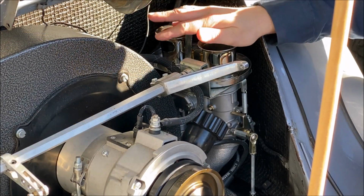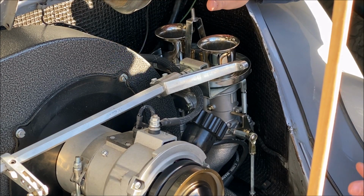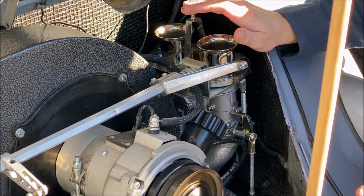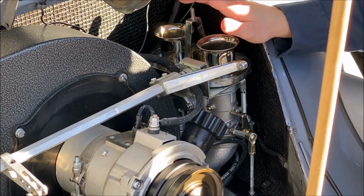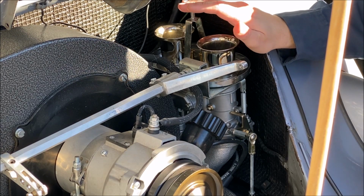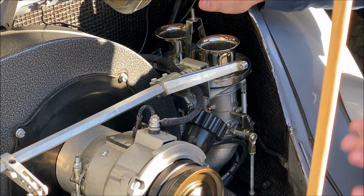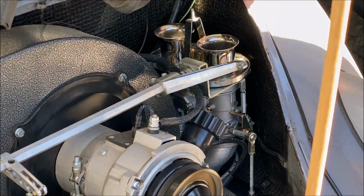That's fun. If you guys remember, these were the very cheap carburetors that I bought from CIP1, and I did kind of what I'm sure everybody does, but what you shouldn't do. We bolted them on. We didn't open them up and clean them out like you should, so that could be part of the issue. Something clogging the needle seat just from us not cleaning them before we put them on the car. But man, we put them on the car and it just ripped. It ran better than it has in forever. I mean, the car just ripped. So we kind of thought we got away with just bolting them straight to the car, and maybe not. So we're going to pull the top off this one and see how it goes.